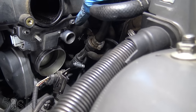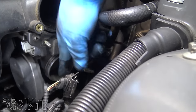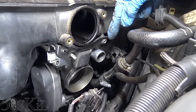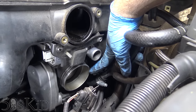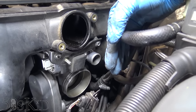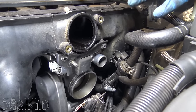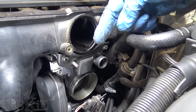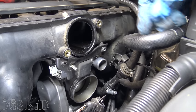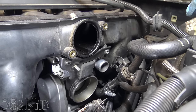Next we're going to pull off the idle air control valve — that's going to be two T40 bolts — and then pull off the throttle body, which has four 10mm bolts on each corner. If you have an M52 TU engine, you're going to have an old-style throttle cable coming through a bracket connected to the throttle body. You'll need to take off the idle control valve and that bracket at the same time. It's like a little bicycle cable — there's a cutout where you turn the cable and just pop it out.